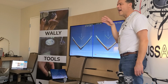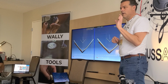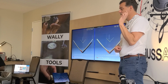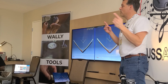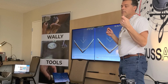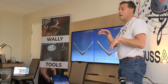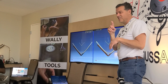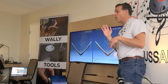So how bad is that? Well, we calculated that for a 4-degree zenith error, which remember is within tolerance, in fact, pretty well within tolerance, for every 7 microns of horizontal travel, you'll get 1 micron of vertical travel. That's a 15% mechanical distortion. And by the way, it works the other way around too. If you've got a perfectly vertically modulated groove, you will get horizontal modulation. In order to get through that vertical groove properly, it will modulate horizontally as well.